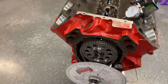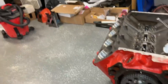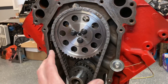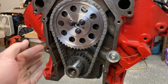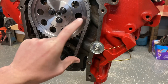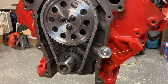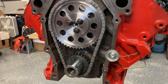But here's what made me think — if you've got an old worn-out 400 or 440, whatever engine, and it has slipped a tooth, what has that done to the cam timing? If you had a very worn-out timing set, this side of your chain would be very floppy and loose, this side would also be stretched. Lengthening this would move this dot that way, so it changes the relationship between the two. I'm going to move this dot up one tooth and we're going to degree it and see what it is.